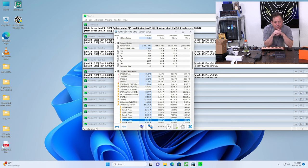Oh, I know another problem. One of the reasons the drives may be getting hot is I don't have the rubber feet back on the case. So the case is basically sitting, blocking its own fan. If I turn the case onto its side, well, now I'm gonna... Totally going to tell you to do that. Well, I'll tell you what, even though I haven't put the screws back in, we'll put these little rubber feet back on here. That could make a difference in the drive performance.